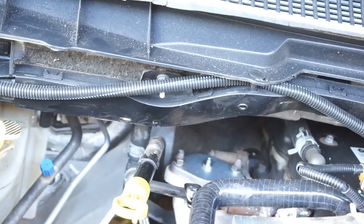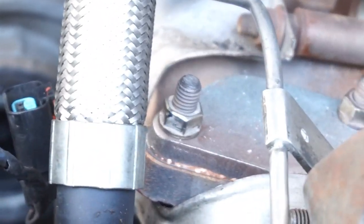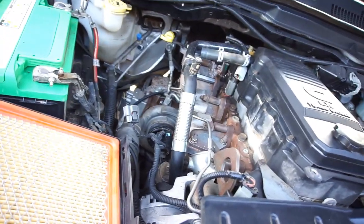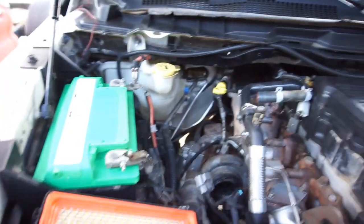What I ended up doing is spraying some copper gasket on the bottom side — went on pretty thick, pretty heavy. I got the bracket on — the bracket for the tranny dipstick — the nut and bolt there.